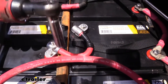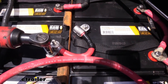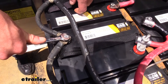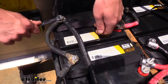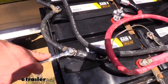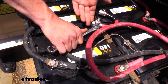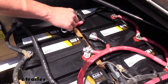When tightening these down, I am using a power tool, but I do recommend that you just run it down to the surface and then finish it up with a wrench so you don't accidentally over-tighten. As soon as it hits, I'm just stopping with the power tool right there, then double-checking with the wrench to make sure it's nice and snug. Since these batteries don't have a stud on top like traditional batteries, if you strip out this bolt it's very difficult to re-tap and put a new bolt in because the metal is so soft.